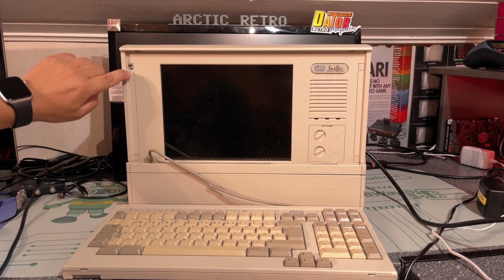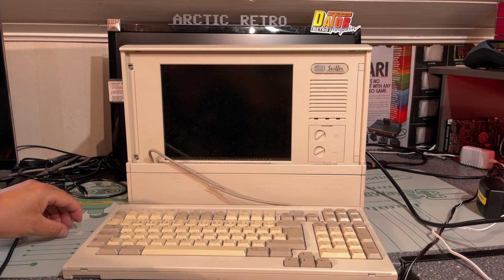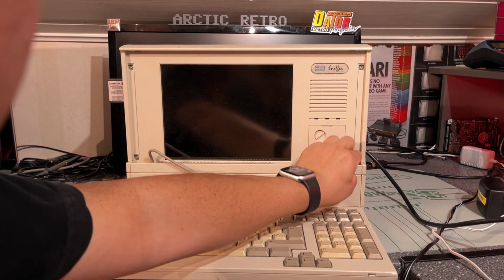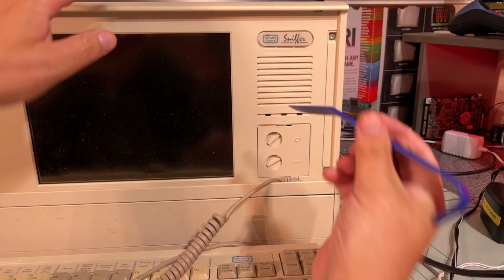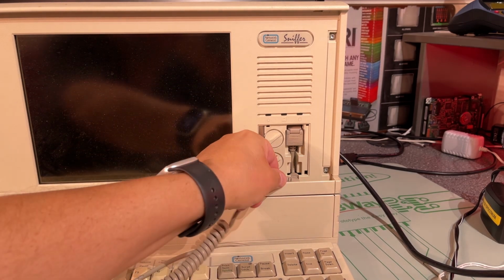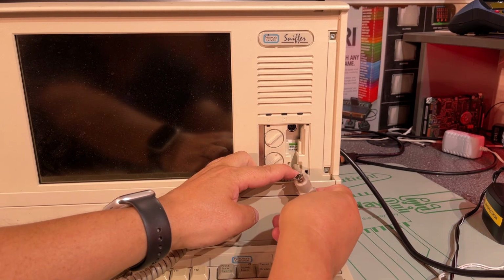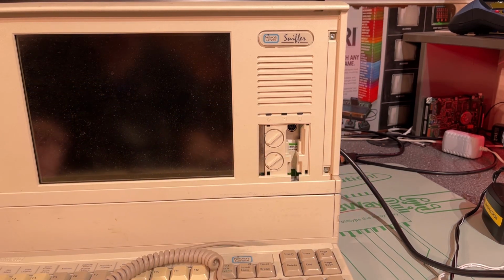Okay, yeah, look at that. That's the screws for the LCD, I guess. Shouldn't lose all these parts, so I need to find any containers to store them in. This one came loose quite easily, and that's the keyboard cable going down there. Always something new to experience. You just pull it out. Seems to be a regular PS2 connector. So now the keyboard is loose.